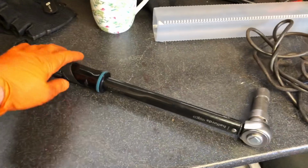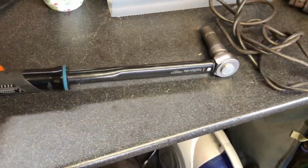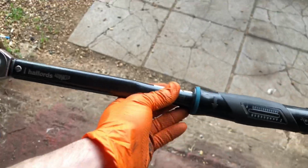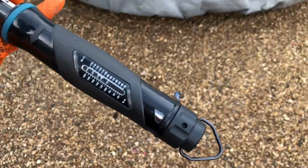Right, so hands up, how many people actually torque down their wheel bolts? These Vauxhalls take 110 newton metres. Now I know you're thinking, how many ugga-duggas does it need to get 110 newton metres? But until you've seen a wheel bolt snap like I have and the wheel actually come off on the motorway, 110 newton metres on the Vauxhall wheels.